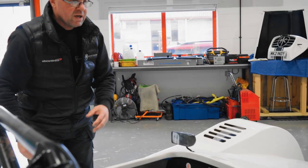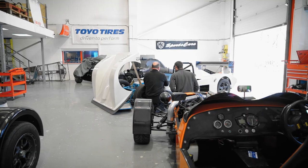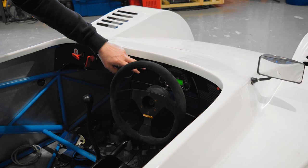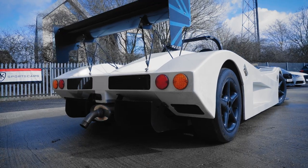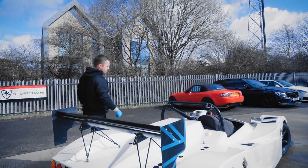The speedo sensor was faulty so we've put a new sensor in and added some magnets, glued on with Araldite. You need to make sure the dimple is the right side down to get the speedo sensor working. That's all done and calibrated. When you crank it up and the digi dash comes up it's a really nice bit of kit. He'll also now have his gear position number on the display — with a bike engine it's quite frustrating not to have that on track. Seeing a big number showing one through six makes life much easier.